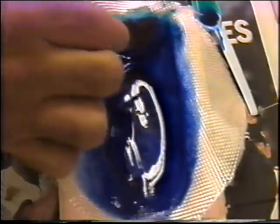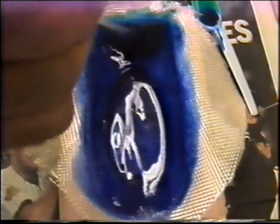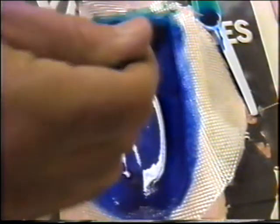Now I have these little carbon fiber reinforcements. They're just little pieces of carbon fiber. I want to get them up in the nose section, because that's right where we're going to carve most of this away to allow the engine to sit through here. What that'll allow me to do is where we locate the pin that actually is the cowl hold down. And I'll put a couple layers of these up here. This is one of the stress points I want to have.